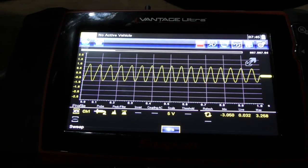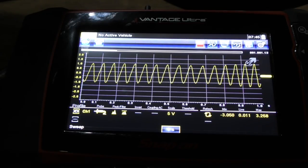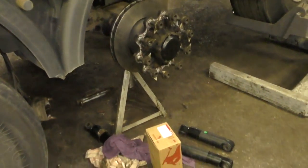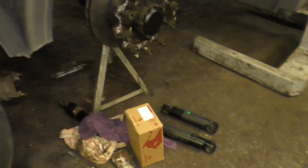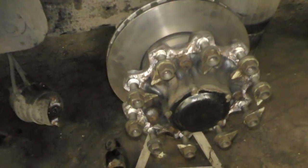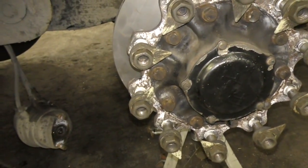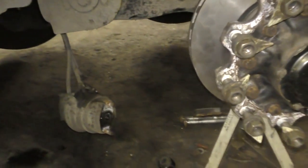If the light had come on during a road test, we'd have had to change the disc and fit another one. Before you ask, this is an ELSA-2 axle system, which is ROR — or Rubbish On Road — Meritor. The fleet is plagued with rotten sensors because they park the trailers down at the docks, so they get all sorts of corrosion issues.